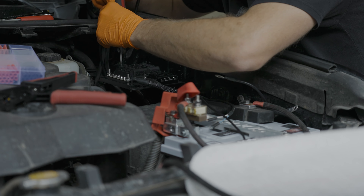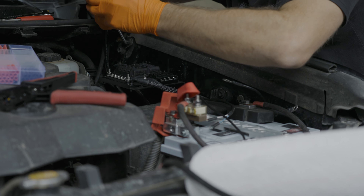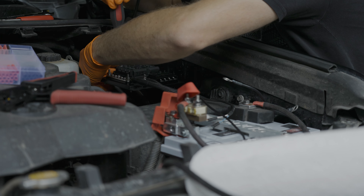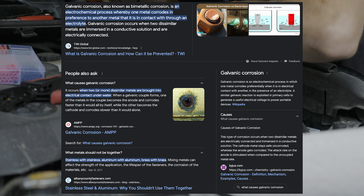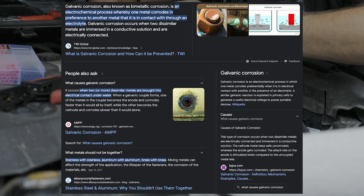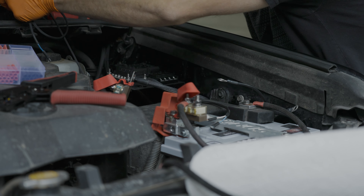I try to do the best wiring I can for my rig — that's why all my cables have jacketing and I try to use nice materials. One thing that Blaze does that I'm super close to trying to source is: all the Amazon ring terminals are a metal that may cause galvanic corrosion, where two metals cause corrosion by being in contact with each other. So no matter how weatherproof you set up your system, you're still going to have issues with moisture and corrosion. All of his connections are incredibly high end, and that's why stuff costs a little bit more when you buy from him.